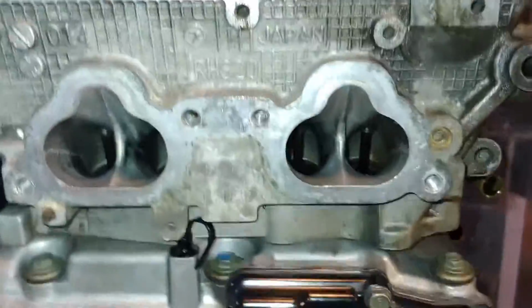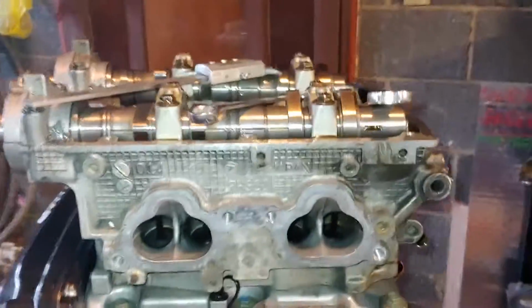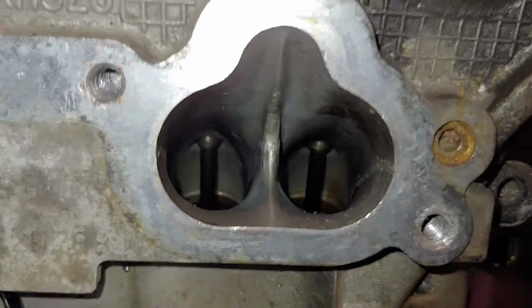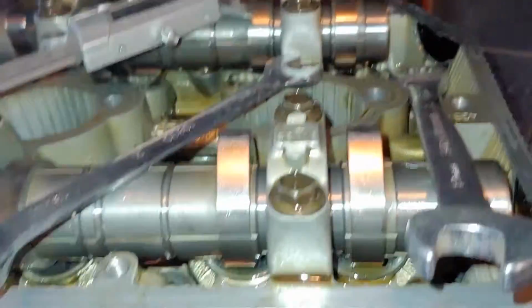Alright, I read on the internet that I got this EJ208 to replace my broken EJ22, and I heard that these 208 H20B heads have bigger ports than the standard WRX. These are 05 WRX heads, the shimless buckets. That's why I like them so much. Put STI cams in them.